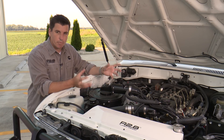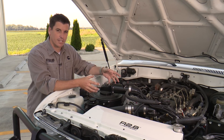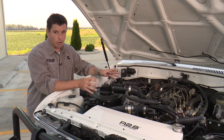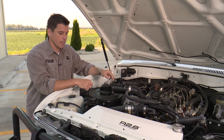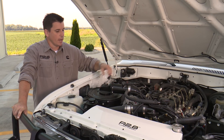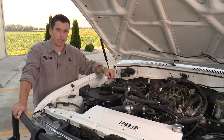We built a feature in that allows you to do a pedal dance, so that even if you're not using our exact spec for a filter and cold air intake setup, you can do an auto calibration at home yourself with no special tools so that it can learn your new intake. This particular builder wanted to retain the Toyota air box that grabs nice cool air from the fender, and then adapted our MAF tube to it before going into the compressor inlet.